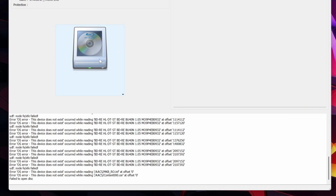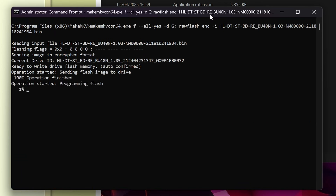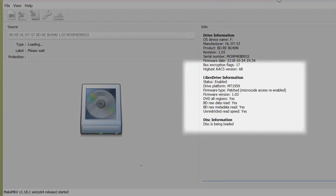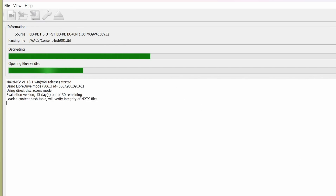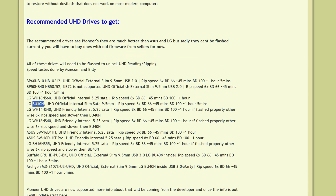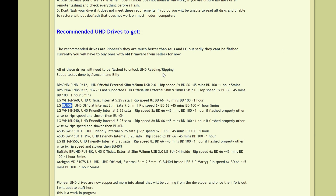A quick word about UHD discs: you may not be able to read these right off the bat. With my Verbatim-branded drive, which is actually a rebranded LG model, I had to re-flash the firmware — to an older version in fact — before I could rip the disc using what's called LibraDrive mode. This is a method that bypasses the usual copy protection by accessing the disc more directly, and it's essential for ripping 4K UHD titles. I was a bit nervous about flashing a brand new £100 bit of kit, and you should be too. It will void the warranty, and there's always a small chance of bricking the drive if something goes wrong. So please only do this at your own risk and follow the step-by-step instructions on the MakeMKV forums very carefully. Don't rush it.